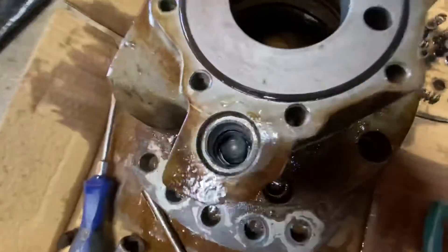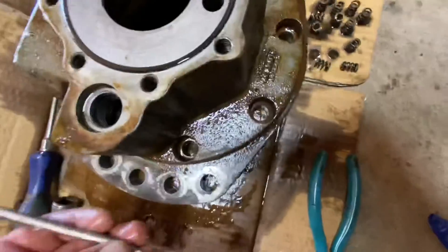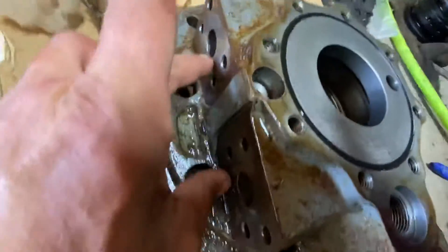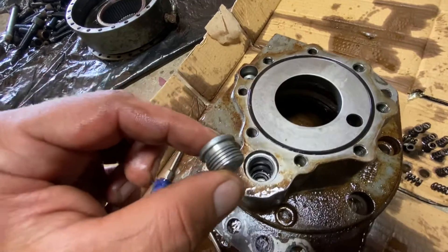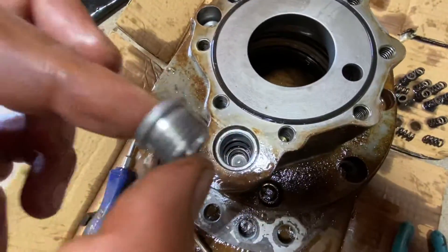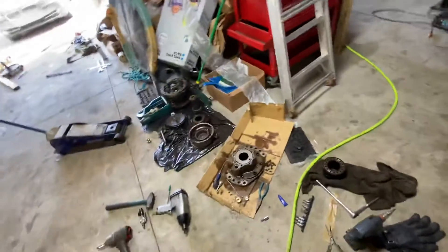So that's what I heard, and I'm like, what the hell? On this side there's nothing inside — I'm like, what is making that noise? Then I decided to take this plug out, and looking inside it was just sitting loose in there. It had come loose. What was happening is the two big hoses connect here, fluid comes in, and without this cap it was just bypassing the fluid — coming in from one side and bypassing straight out. No plug, no pressure. That's why it wasn't making any noise or moving.